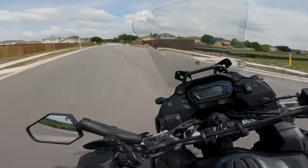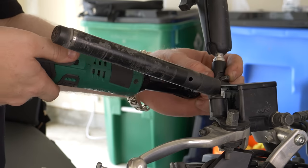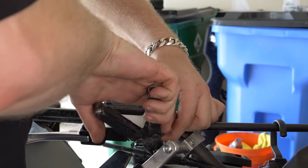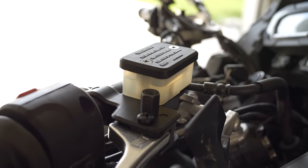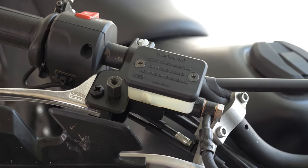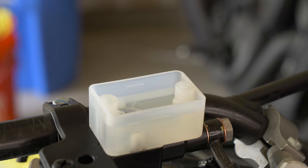Replacing your master cylinder is probably where you ought to start if you're looking to improve your lever feel. It takes a lot longer, but you're guaranteed to get better results. This Magura Master Cylinder has a bigger bore, meaning you move more fluid, and it's a more sophisticated unit than the ancient relic that the stock KLR650 comes with. One benefit of going for this straight away is that you don't have to worry about bleeding the brakes twice. Just drain the old system, unbolt the old master cylinder, pop the new one on, and when reinstalling make sure the new master cylinder has proper clearance so everything moves as it should. That's the one issue with universal parts — they don't tend to mate up perfectly the first time; you may need to fidget with brake line placement or throttle cables. Once done, bleed the brakes to get rid of all the air you've introduced.